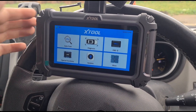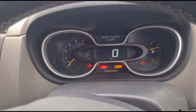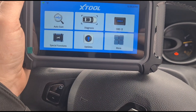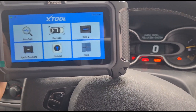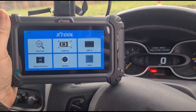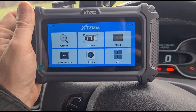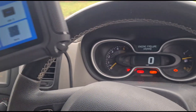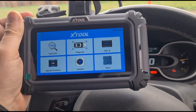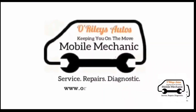So that is the X-Tool that I'm looking at here. We can see that it's capable of doing the diagnostic scan on the vehicle, it's capable of reading the live data, and it's also capable of doing some of the special functions. The special functions on these Traffics are pretty limited on most scan tools anyway — we've only got the regeneration option there. Once everything's reset we should be able to reset the fault codes once we've got the repairs done. That should be the end of that — I'll see you on one of the next videos.